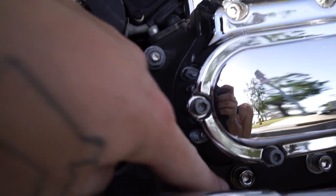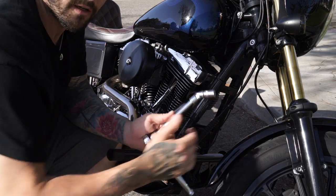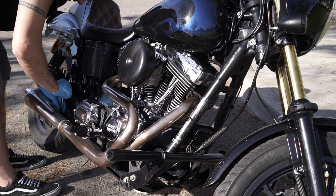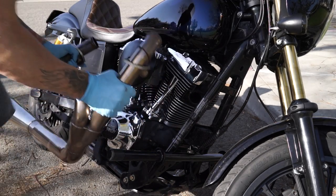The first thing you're gonna want to do is loosen up all your bolts — those are your head bolts. Loosen up your head bolt here and there's one underneath, two on each. Then you have to loosen up and take your bracket off the old exhaust. The bottom was a little tricky so I used a swivel on here — makes it easier. As you can see the exhaust has a giant hole in it. It's been a really good exhaust for the past year and a half but wear and tear has taken a toll and it's just time for an upgrade.